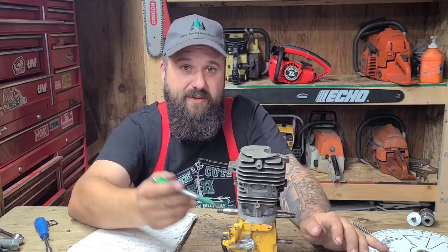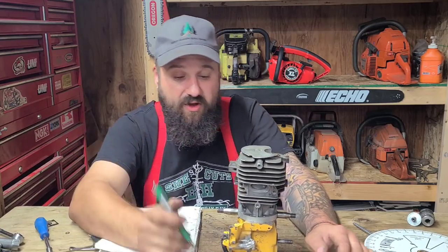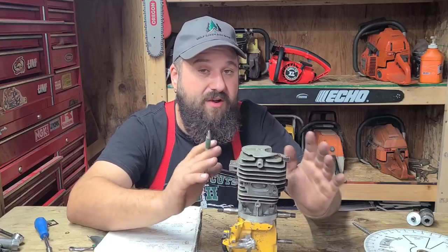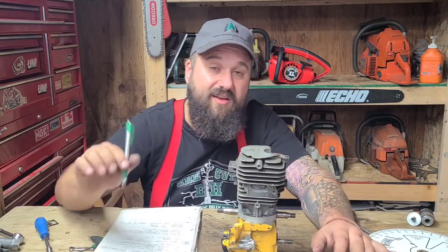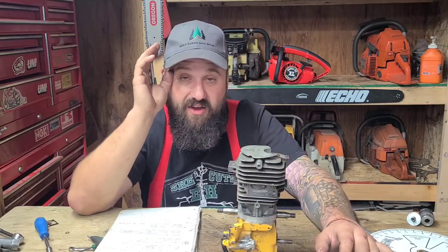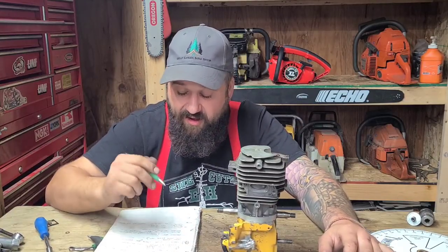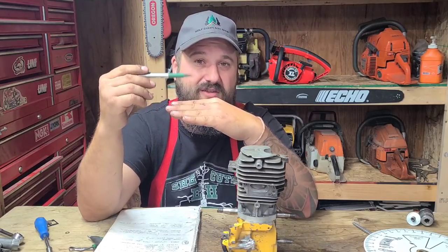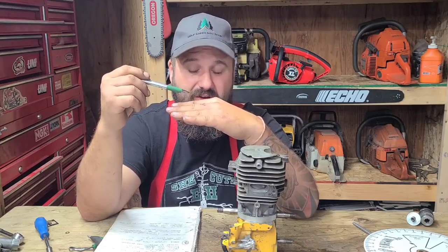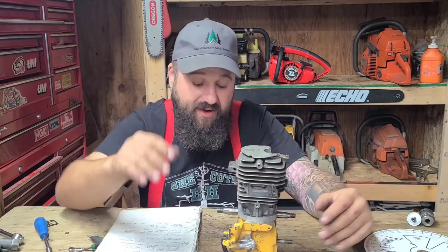I left the exhaust port shape as-is and left it to the left. There's a lip around the whole exhaust port — I got rid of that lip. The old timers that have been doing this forever say they take the lip out. A lot of guys that ported back in the day didn't use a timing wheel, but I cut that lip out and got five degrees of timing on the exhaust. The exhaust is now at 99 degrees. I've lowered the compression in this saw a little bit, but I've gained blowdown.